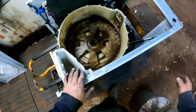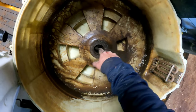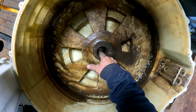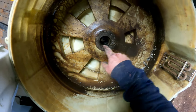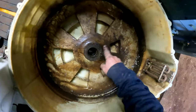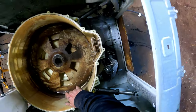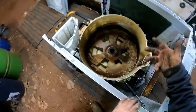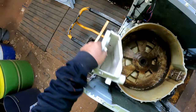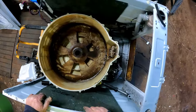This is the stage where you've almost got the whole thing apart. I try not to take any plastic to the scrap yard. That bearing is shot - wow, she's wobbly in there. Definitely got to replace the seal - she's eaten out down the bottom, just yuck. I'll give that a gurney out too. She's definitely got to come out. We'll continue on taking the rest out. I've got to look at the bearing number so I can order parts - definitely going to be repairing this one.